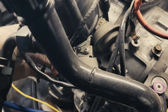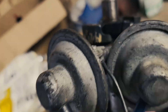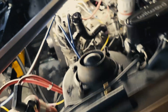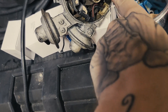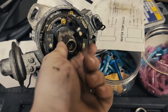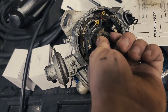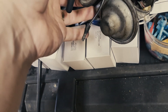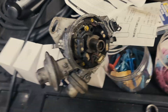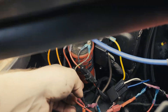The wiring — you're going to want to take your condenser, which is this little pill thing on the bottom of the secondary housing right here. This little plug comes out and actually goes to 12 volts. What it does is it condenses the voltage spike from when the contacts pass over the pickup. When it breaks, it spikes the voltage, and this condenser absorbs that. You need that because eventually it'll burn your trailing igniter out. So the condenser gets wired into 12-volt positive.